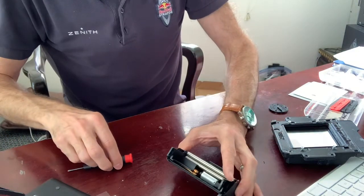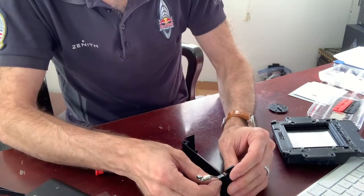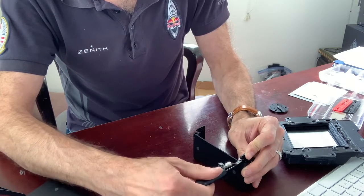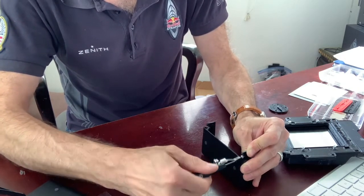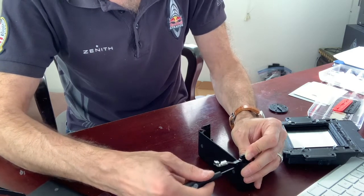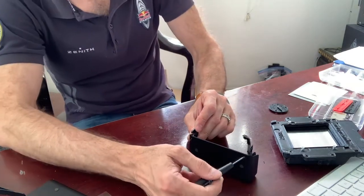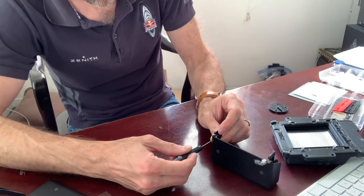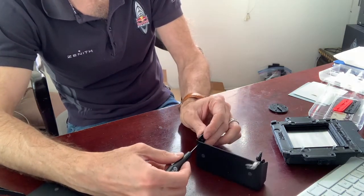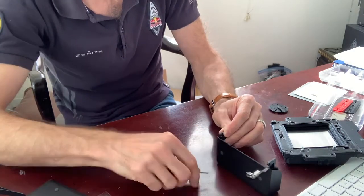I think it's okay right now. After this is done, place this vertically and take one of the black screws you removed from here and push it in — let's see if we did it right. Don't over-tighten it. Then the other side. I start with the screw on the same side as the connector. It may need a little wiggling because it's not pushed all the way to the wall. Just wiggle a bit until you register the holes, and I think it's back on. Battery replaced — nothing seems out of place.